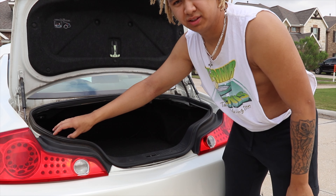Alrighty, let's get to it. We're going to have to cut the black right here, and the green with the yellow stripe. So we're going to cut these two. Now, other videos on YouTube are explaining it all wrong — the out goes out towards the light, because the power source is coming from this one, so it goes in to out. Everything going out to the light is out, everything going in is in. Make sure you guys don't get that twisted. I've tested it both ways, and this is what works.